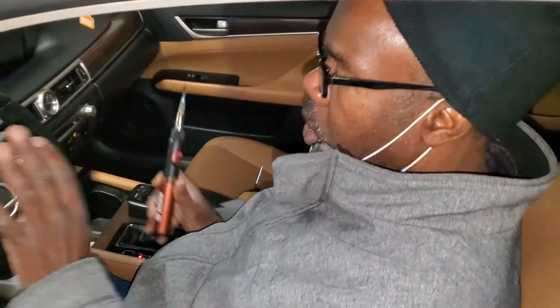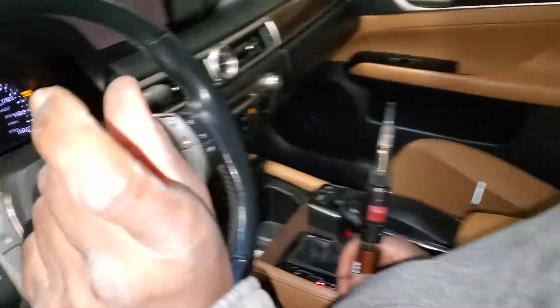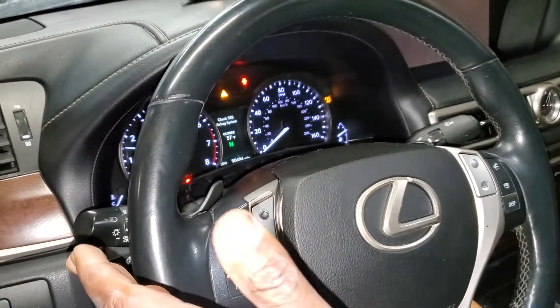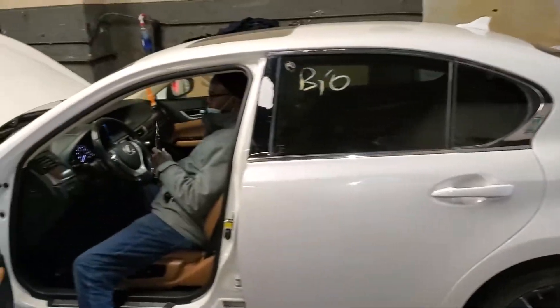Yes, the car started! The whole problem in this car was that the fuse link was damaged. When the fuse didn't reset, it cut off power going to the car and prevented it from starting. We are going to open that fuse box, take out the damaged fuse link, and order a new one so we have a solid connector. Now we'll be able to move the car. The fix was the fuse link — thank you for watching Mobile Electronic. This is Mohamed. See you in another video.